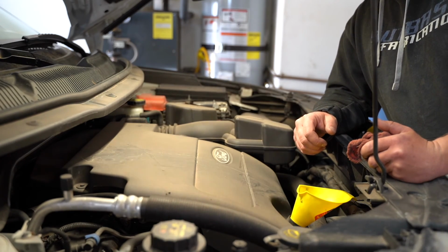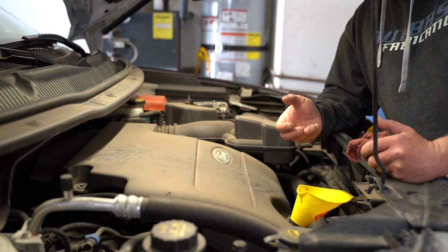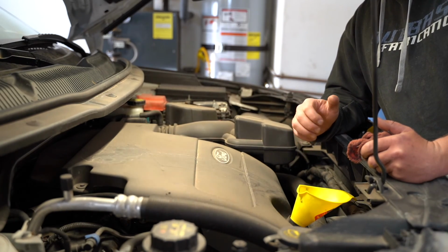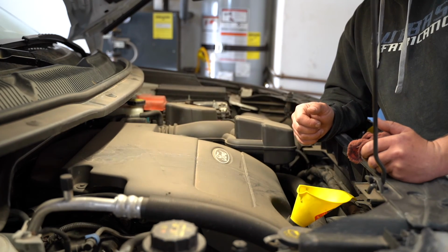It's a little challenging to do. I recommend starting up at the front, put your front two clips on, then moving to the back, put your back clip on that skid plate that's underneath the vehicle. Again, we're done at this time. There's nothing else to do.